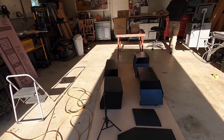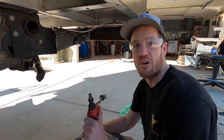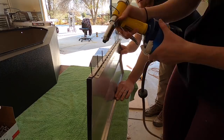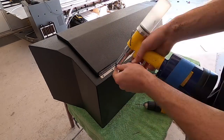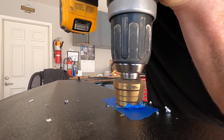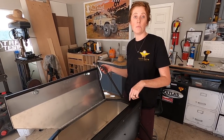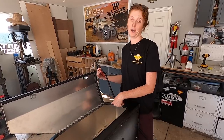I got a notification that it was going to rain last night, so we ran out and put everything in the garage, but our underbody boxes are dry and we can reassemble them now. We're installing stainless riv nuts into the bottom of our subframe to hold the underbody boxes in place. We have the rain gutter on the box, and we want it to seal and also not rattle, so I'm putting a rubber seal on the inside of the door that will close against the gutter.